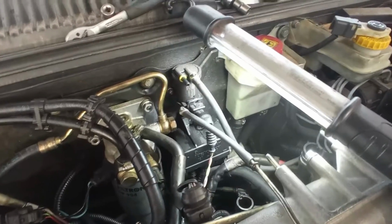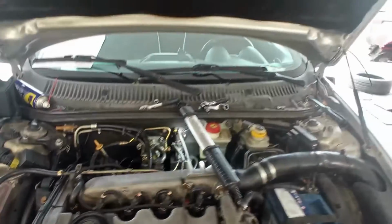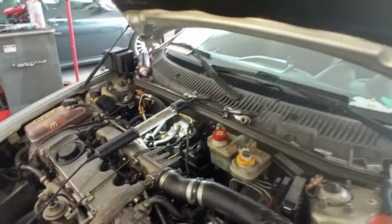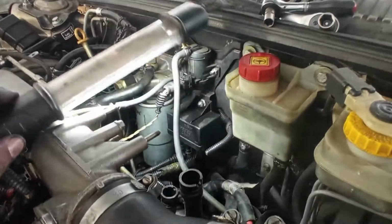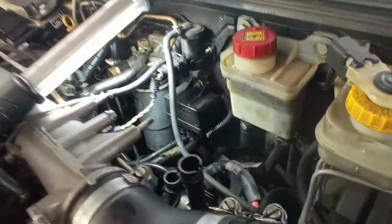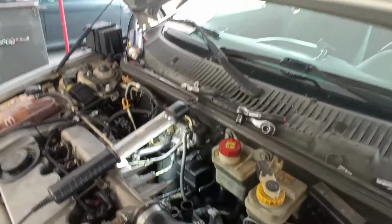A lot of stuff that I found was disconnected, badly connected, just wrong altogether, like here the preheater box for the glow plugs. In my country, I do not have zero-degree temperatures. If I have, it's one or two times in the year, and we do not need this function to start our common rail, direct injection cars. It was disconnected because the clips that hold down the connectors are gone, so the vibration took it out. But it will do for stabilizing idle, not providing idle, okay? Two different things, just stabilizing the idle.